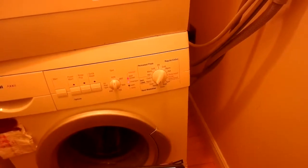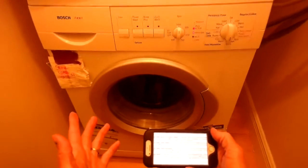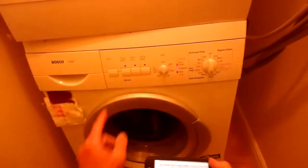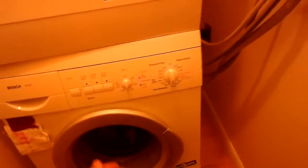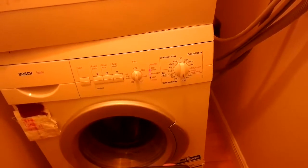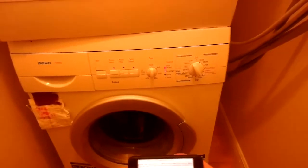We're going to end that test. Next we'll go to cold water — I'll go to drain and press start. It's just cold water, normal cold water coming in — looks good, seems pretty solid. I'll turn that off. Now rotating to soak, that's going to test the dual cold water pre-wash and wash on soak — that sounds pretty strong too. You can see the water coming in.